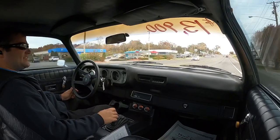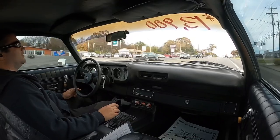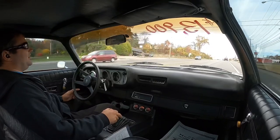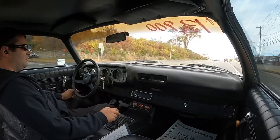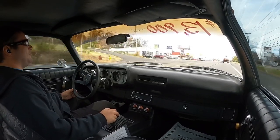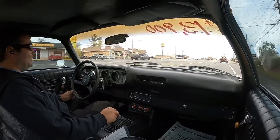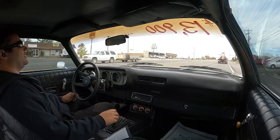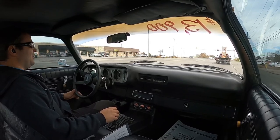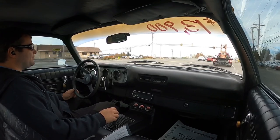A little bit of a hesitation in that car if you hear the popping. Kickdown's not hooked up on this one. Let's take her down a gear. Get her down. There we go. Seems to be a little bit ethanoled up. She's still real peppy. Might have to get her going down the road some more. Maybe get her cleaned up. Get some of that stuff out of the carburetor and see if all that'll stop. I know a lot of times if you just drive them, it usually helps.